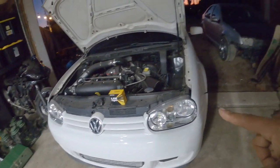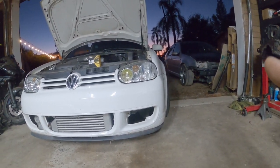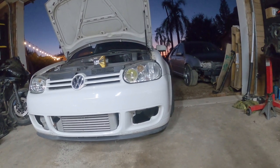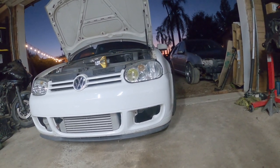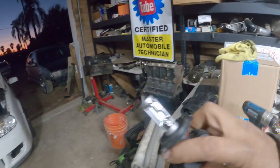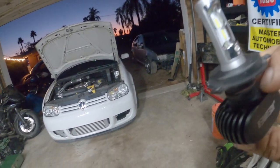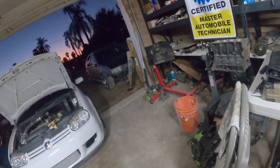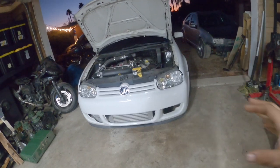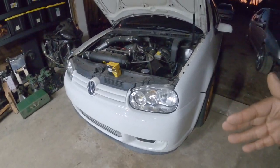The reason I did that is because I wanted that blue tint housing. You can see the bulb on the left — my high beam is yellow and the bulb on the right is blue — I wanted that look to it, but they're not very bright. That's the thing you gotta understand: halogen bulbs only get so bright. Now you can dump in an HID or an LED bulb, but the problem is bulbs like that are not designed for halogen housings — they can fire light and scatter it too brightly and blind people in front of you. We want a bulb that can mimic a halogen bulb but get the performance of an LED.